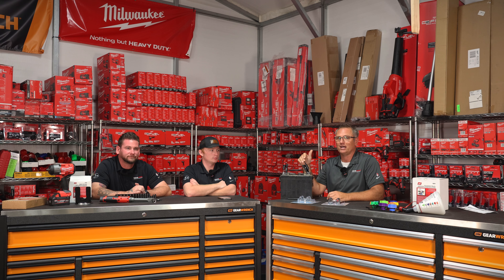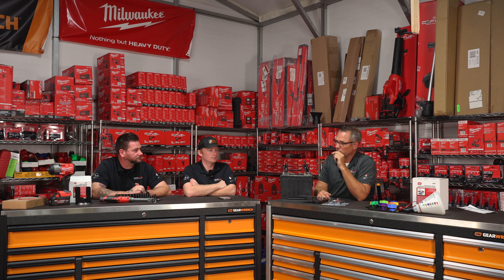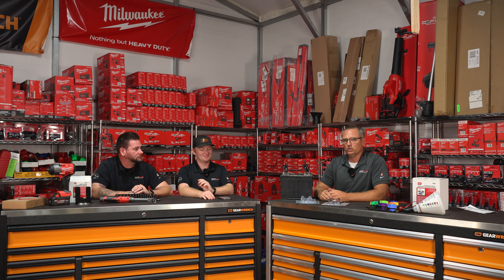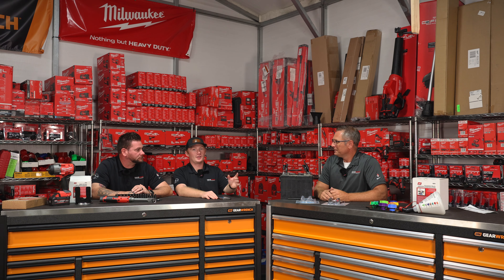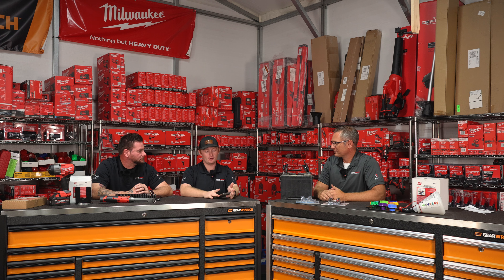We're actually going to do a TikTok and an MLive demo on this very soon. One cool thing about this: if you can't hold on to the fuse box and you're trying to test like a mini-fuse, you can actually hook this onto the relay and send it into the fuse so you don't have to have someone hold it — because you can't always take a probe and pierce a fuse since it's hard plastic. So you have to hold it on there. For electric diagnostic guys, pick one of those up from Tech's Choice Tools for a really cheap price.